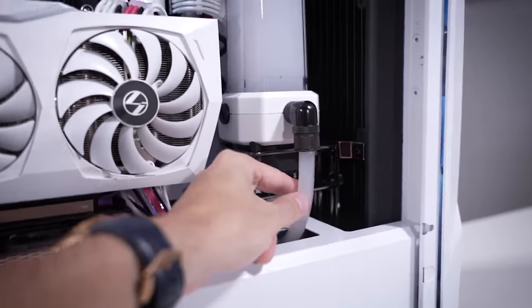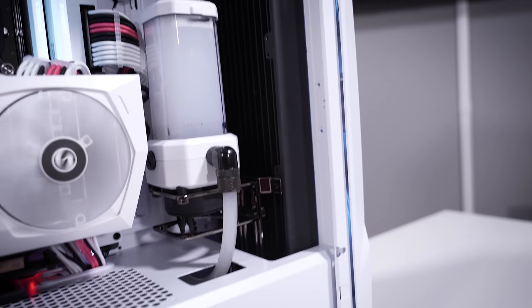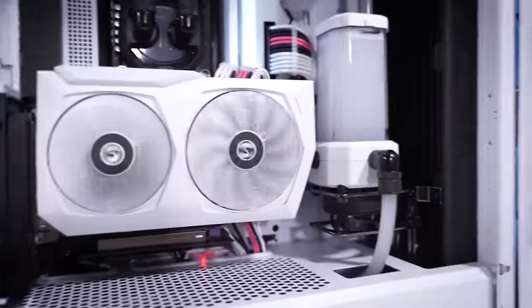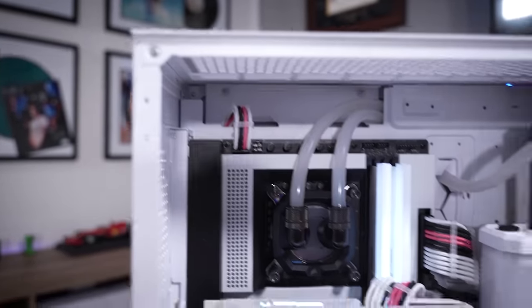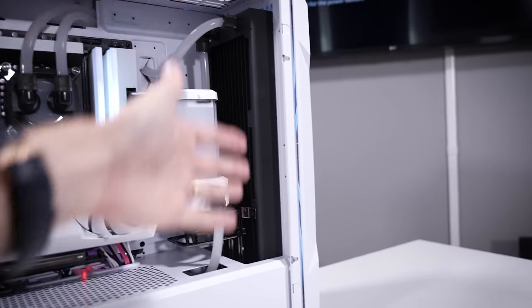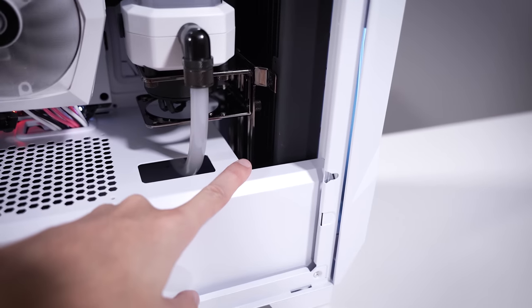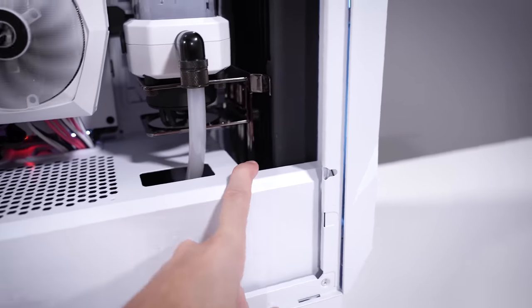The pump needs to be recalibrated just a bit because it is a tad weak - I think I ran it into one of the chassis fan headers, so that'll be easy to fix in the BIOS. I'm not seeing any leaks - that's really good. The pink is just, I'm really glad I added that. Just a bit of subtle coloring really tops off a build. I love the way that CPU block looks - all this gear is mostly from Corsair's HydroX lineup. There is an EK 360 radiator in here, just a bit thicker. You can fit a thicker radiator in the DP505 because the fans are placed in front of the main chassis - something closer to 35 or even 45mm thick up front, which is really nice.